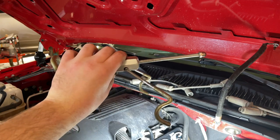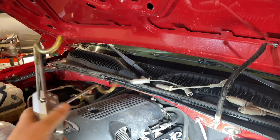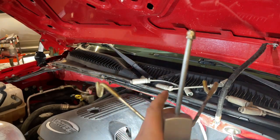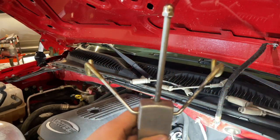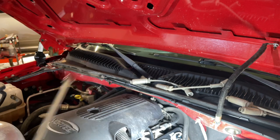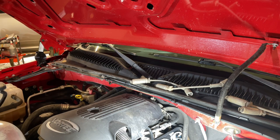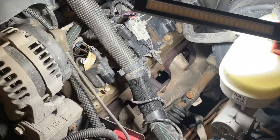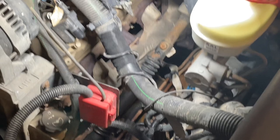This is my steering wheel holder. I have an alignment machine and a steering wheel holder so I use this - it just sits underneath the wheel and comes up to hold it. If you don't have one, you can just wrap a bungee cord in there to hold your wheel straight. You never want that steering wheel doing 360s at any time. So I'm going to hook that up and then take that bolt out of the steering shaft.